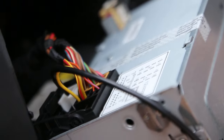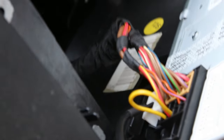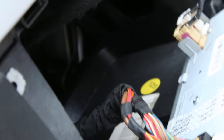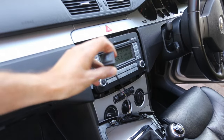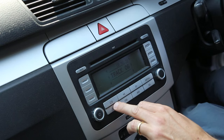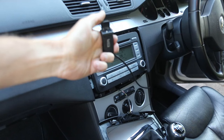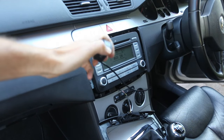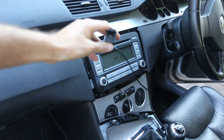If we look at the back here you can see where this connector is just clipped in — that slots into the CD changer port and you just need to pop that in. Once the wire is connected we now have our AUX lead with an AUX socket, and if we press CD you can see it says AUX In, so we'll be able to play music from your phone or other device with a 3.5mm jack socket.